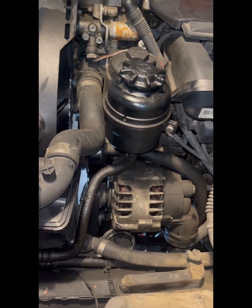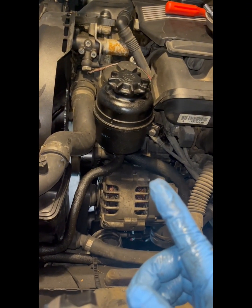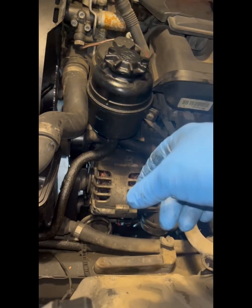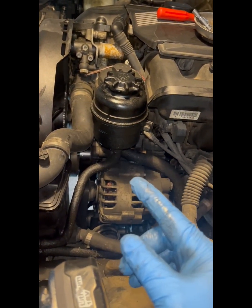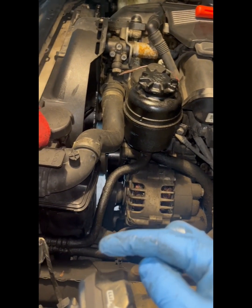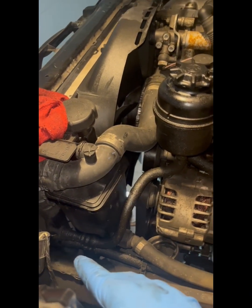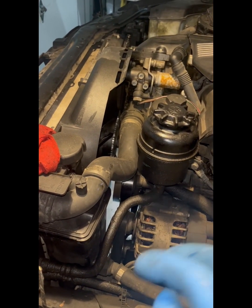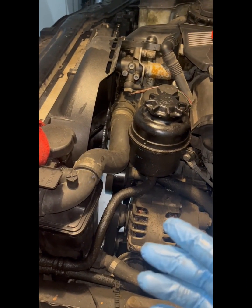All right, so it's draining from the bottom right now, and I'm going to go ahead and start taking off the reservoir. All I want to do is take this 10 bolt out and move the reservoir out, and then I'm going to disconnect the lines off the bottom of them. So this one will go to the pump. This one goes to the coolant system here. So I'll take this off, take those off, let that continue to drain, and then I'll go on the bottom and finish taking out all the stuff on the bottom, and I'll let you see that.